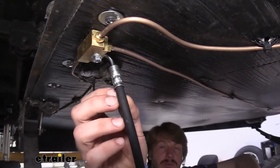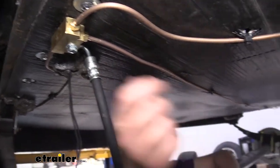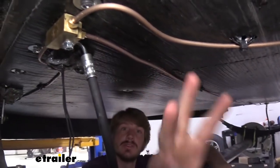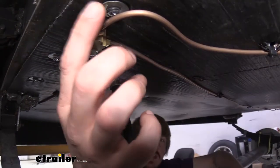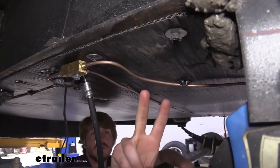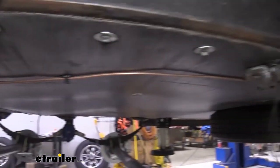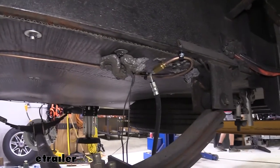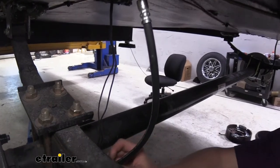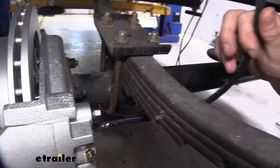Out of this four-way block, your second-longest line is the one that goes from one side to the other — it connects to this union and goes across to the other side where it connects to the three-way union. The port here on the back is one of two short lines in your kit — those go from one axle to the axle at the back, so we come out of this, it runs around and goes to the axle back there. Lastly, our flexible line goes from our caliper up to our union here, and you can see our connection where we're all connected.